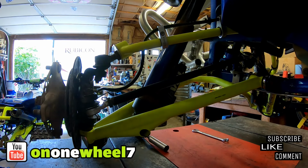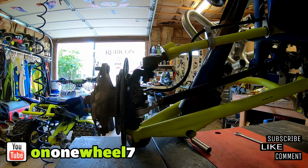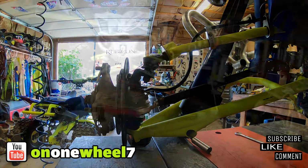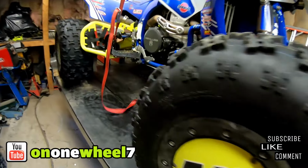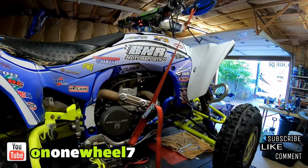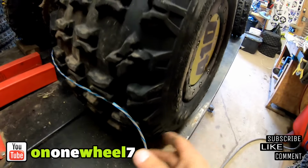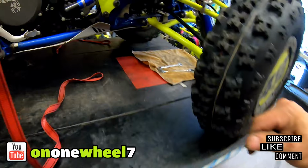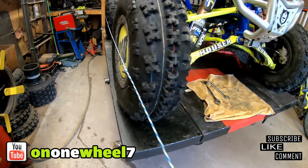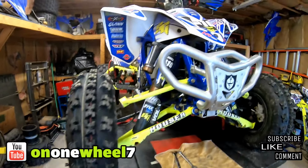Those are on, those are tight. Get the tires back on and then we'll line it up. Alright guys, so here's what I'm going to do. I'm going to put two straps, lock the handlebars as straight as I possibly can. Then I got a string on the axle. So I'm pretty much just going to run this string like this to give me a measurement on toe. I'll do it on both sides, try to get my eighth inch on each side the best I can.